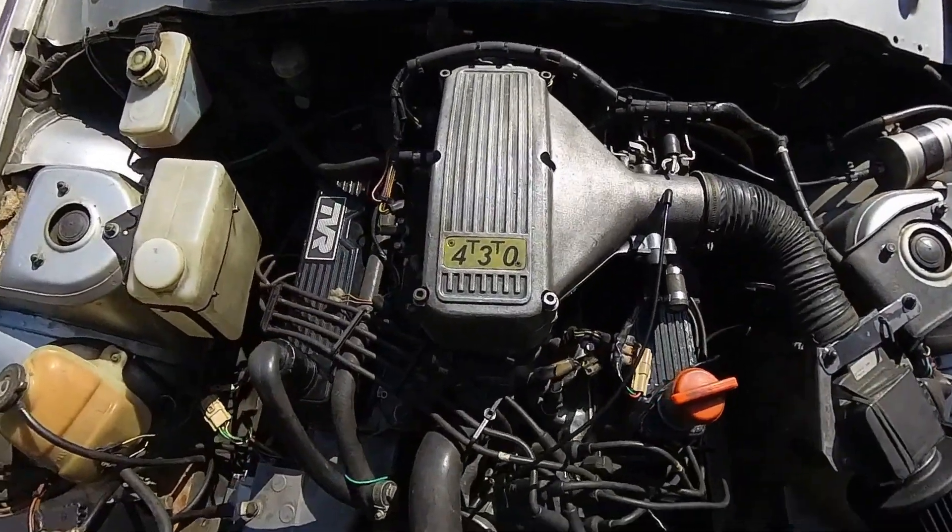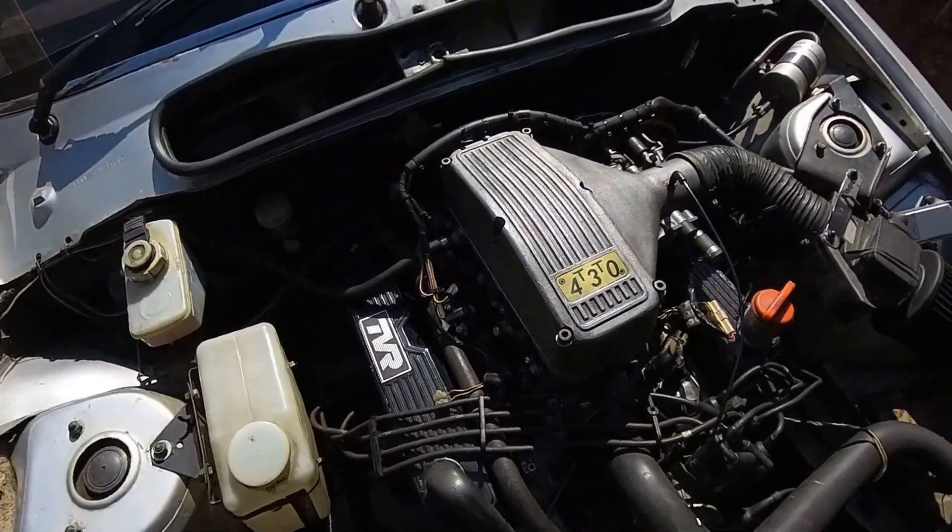Caveat with all this: you'll be screaming at the camera saying 'REV IT MORE!' but we don't really go much beyond 5,000 revs. Due to whatever reasons, there are some very old valve springs in there. We've actually fractured a valve spring just a few months back while driving it rather enthusiastically. So we're not going to be revving it to six. We do find peak power though - it's about 4,800 to 5,000 RPM depending on the timing.